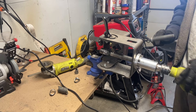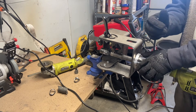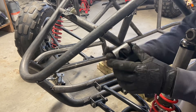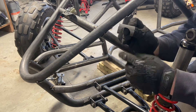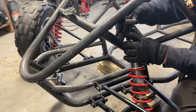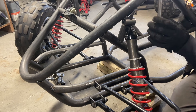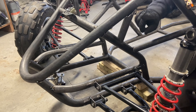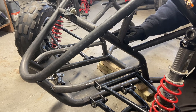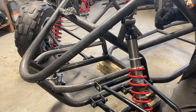When I do an offset cut, I reset this right after I make it so I don't waste a cut on a longer tube. Here's what your piece should look like — just a hole saw cut. Looks like I did three-eighths instead of five-eighths, so it just needs a little extra trimming. Then you put this on here, make tabs for this, and you can put this anywhere you want. You have an easy shock mount, you have triangulation, and it's mounted to a crossmember — so not only do you get the strength from the welds, but this is pinched in, so it would have to bend a lot of things to break loose. That's exactly what you want when it comes to suspension — strong, not just two tabs randomly placed somewhere.